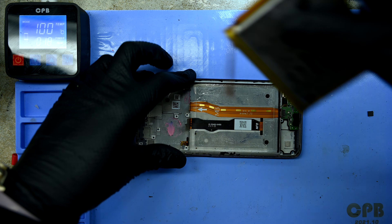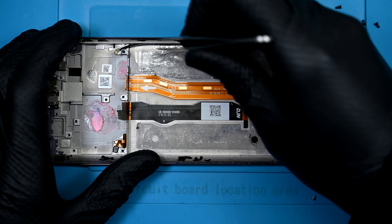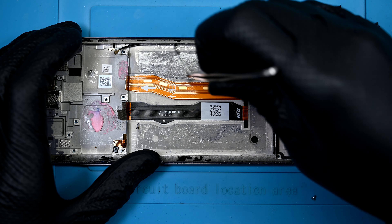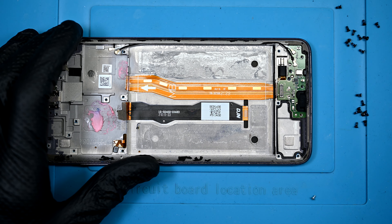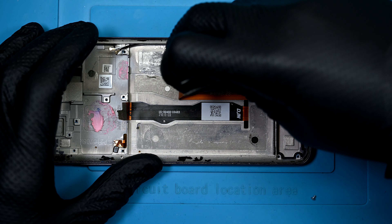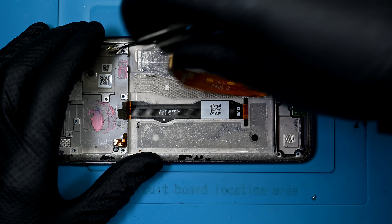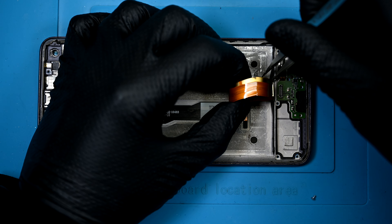The battery comes out with some heat and alcohol — check out my previous video on how to remove them if you need help. A black strip of electrical tape holds the antenna lines in a trench next to the battery compartment — this could have been designed much better. This long extension ribbon is also secured with a Motorola seat belt under the battery compartment. I can't wait for this design to be phased out and replaced by something intelligent.